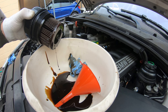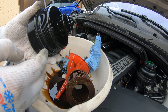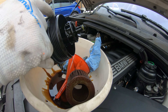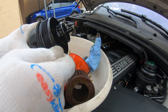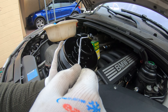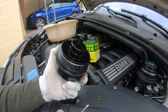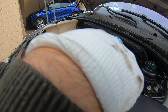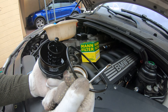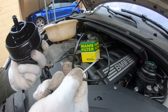There's the old oil filter. Now what you're going to want to do is take this oil filter off. In the kit, we're going to replace this little rubber O-ring and the bigger one. Use a pick or screwdriver to get at these and replace them. The reason you want to replace these is that heat makes them hard and brittle — they can break and start leaking. So you want to replace these.